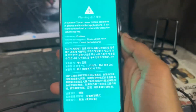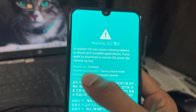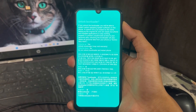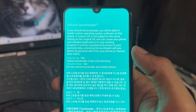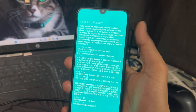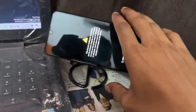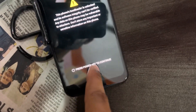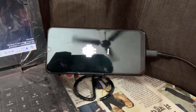Now the next step: it shows some warning on the screen — ignore it. As we can see, if you read it, press Volume Up for some period. So press the Volume Up key for a few seconds and after that it will show the unlocking the bootloader screen. Just once click the Volume Up key. It says once click Volume Up key for unlocking. After unlocking finishes, we can see the warning: your bootloader is unlocked, your device is not secure. Ignore it, don't worry about that. This is the process for unlocking the bootloader of any Samsung device.